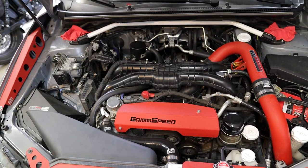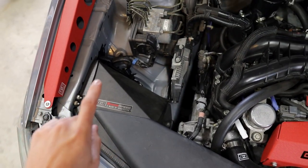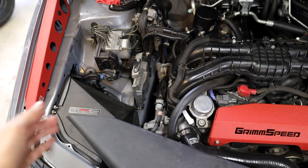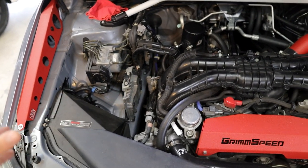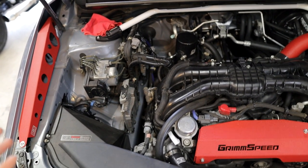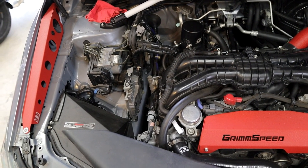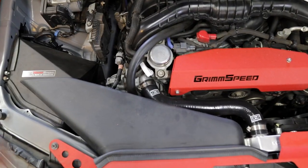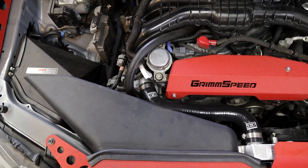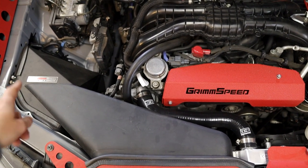Now for the power mods. Easiest to see is the Grimmspeed intake — I love it. It sounds great and performs well. A lot of tuners prefer it over other brands because the filter position is locked into one specific place so it can't shift horizontally on the intake tube — there's one spot it latches, which makes MAF readings very consistent. Down below I have the Grimmspeed turbo inlet — the aluminum cast one — which connects to the intake. I'm still running a stock BPV.